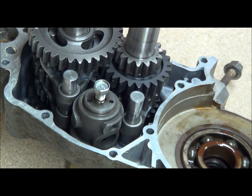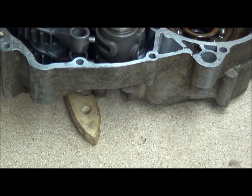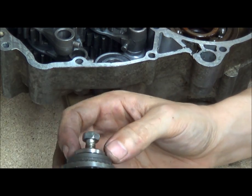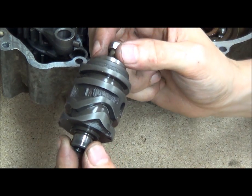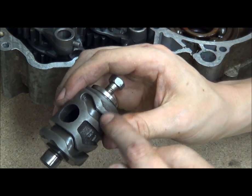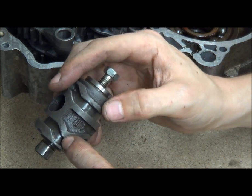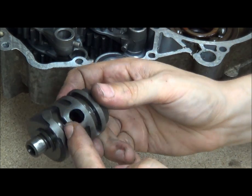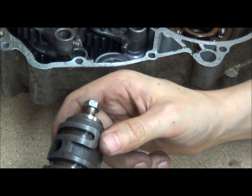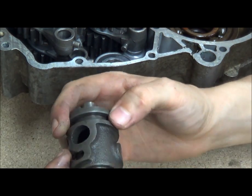So what we'll do is pull out the pins - these are basically just the shafts that the forks ride across. So basically this is all it is, it is a channel. There's your stop and that's first - neutral's about there, see where neutral is. Neutral's on the edge of this dropping down into second and then up into third, and then basically all the way back around again. The reason this one goes all the way around with no stop is you only need one and two stops - that is the entire movement of the drum, that's all that's needed for all five gears.